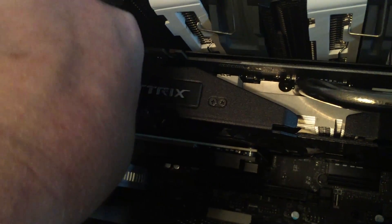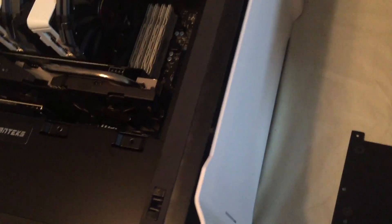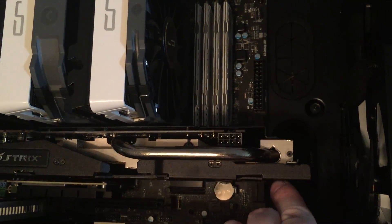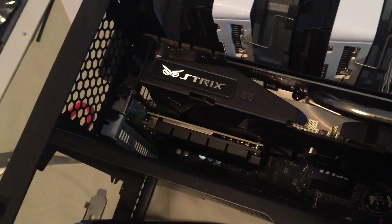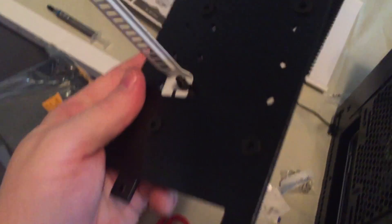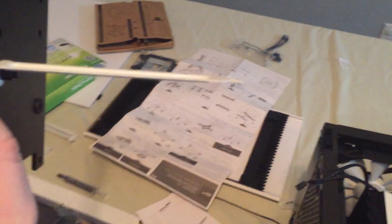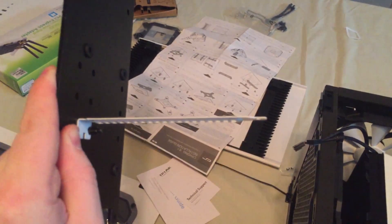Here's a problem we ran into — if you listen carefully, these slots are so close together that the card sagging a little bit is actually making the GPU fan make contact with the wireless card, which is not good. So what we're going to do is use this plate that comes with the case and attach something to prop it up. If we prop up this card so it's more flat, it gets the fan out of the way. We came up with a solution using a screw on one side, a standoff on the other, and a PCIe bracket to hopefully prop it up just enough to keep it from hitting the network card underneath.